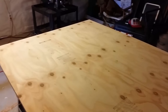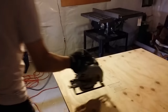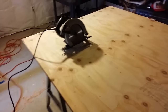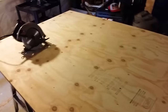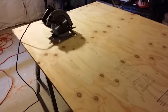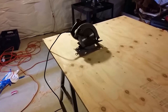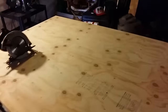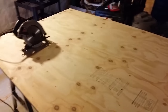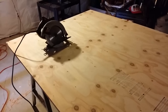The inside of the bus right now is fully insulated. The floor is insulated with rigid foam insulation. So what we're doing is cutting the pieces, gluing the insulation down, and then gluing these pieces to the top of it. They will work as anchors. The tongue and groove should hold it all together really well, and around the edges I'm going to use liquid nails to hold everything into place so it doesn't shift around.